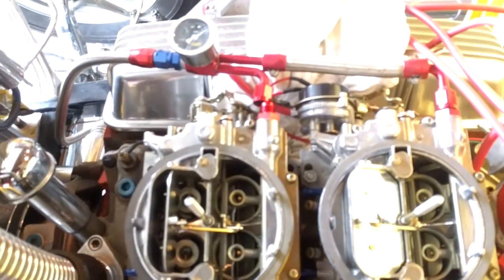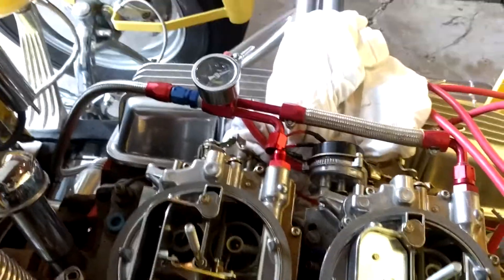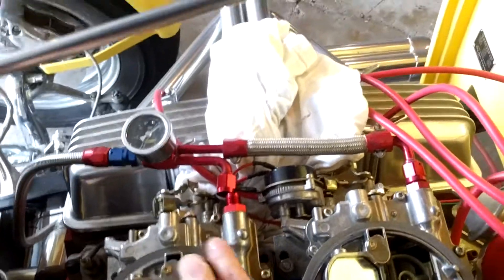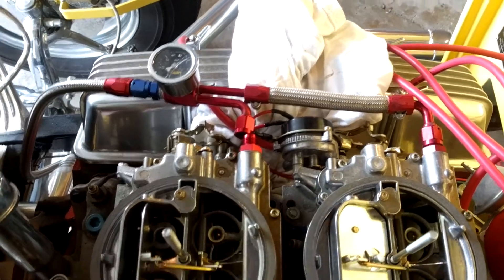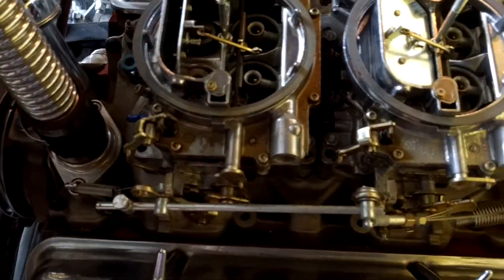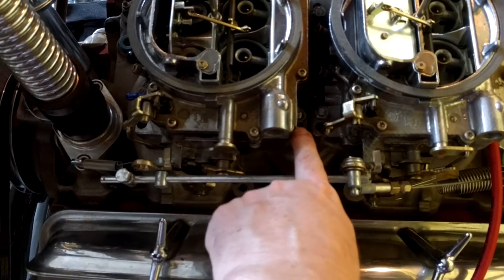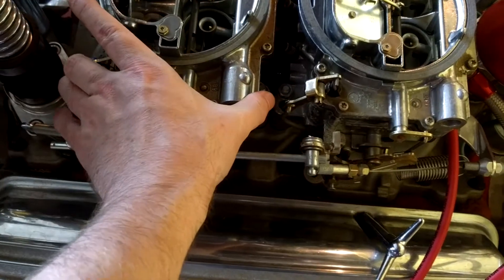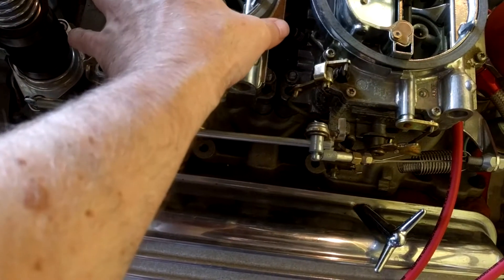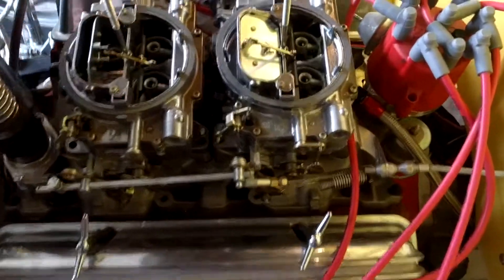The middle one I cannot get to — that's the big one, and it's right up against the front carb. So I had to take the fuel line off. Finding the right wrench — figuring out what size — it takes forever. There's this linkage here, but the bolts holding the carb down were half-inch nuts. I got all four of those off and I'm going to try to take the carb off. I might have to undo the linkage, but I just need to get it up and out of the way enough to get that boot off, then bolt it right back down.